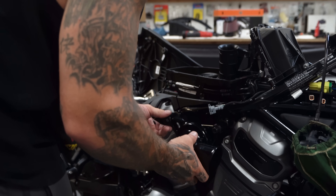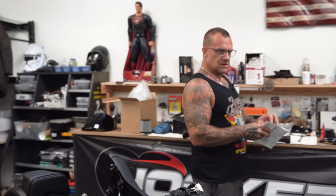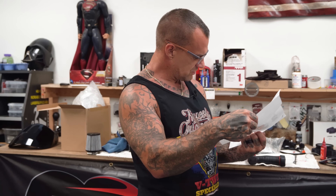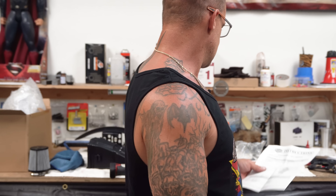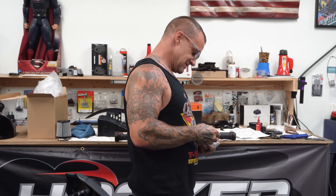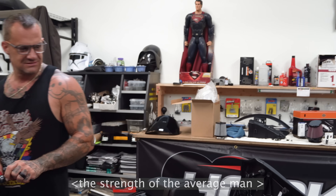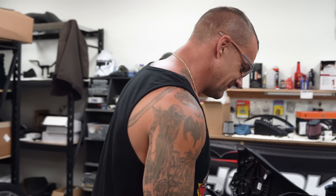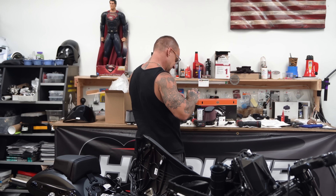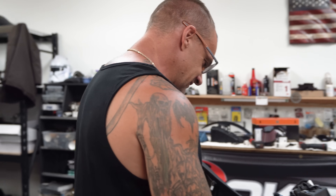Does this come with different hardware? Because this bolt isn't long enough. I guess I should have looked. It comes with directions. See if it's got a torque spec. Holy shit — Trent, guess what the torque is on these intake bolts. Anybody got a guess? 35 is your guess. 88 foot-pounds. 88. That's a lot. They're also the motor mounts though — it's a twofer. But 88 foot-pounds on these guys — they're not even a half-inch bolt.